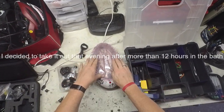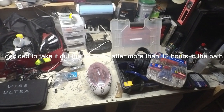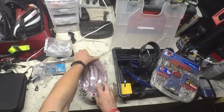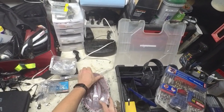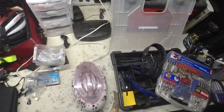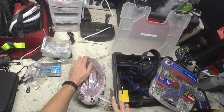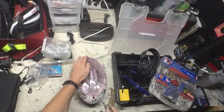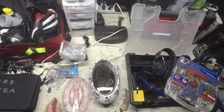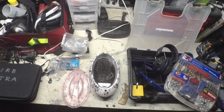I'm going to leave that until tomorrow and take it out. So here is the next part of the chain waxing procedure. The chain's been sitting in this bath all day. I'm not going to leave it overnight because I actually want to get out here early in the morning, so I'm going to get this cooling off now. One problem is this lid has some wax and it's been getting stuck down — probably should clean it off at some point. There's the chain. Again, all that black stuff is molybdenum disulfide.